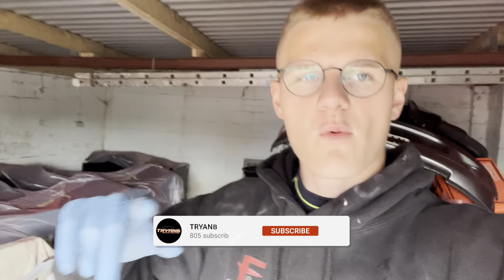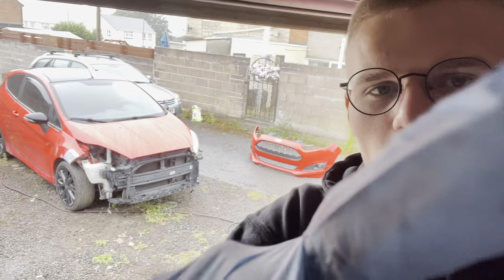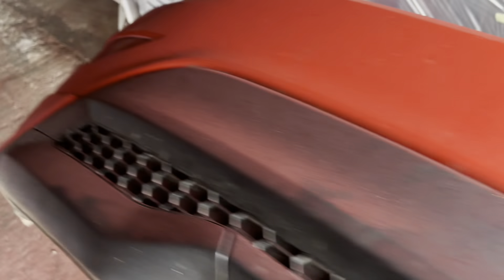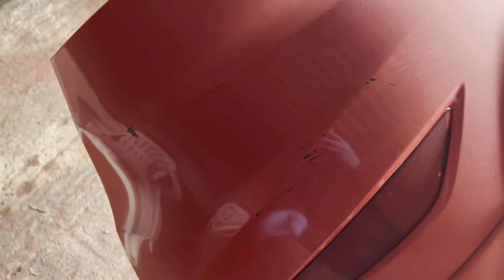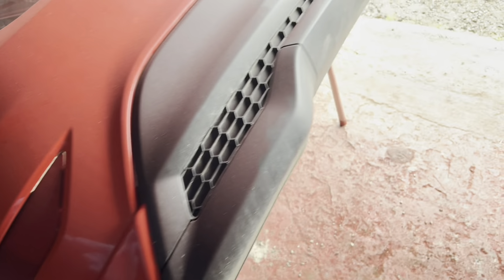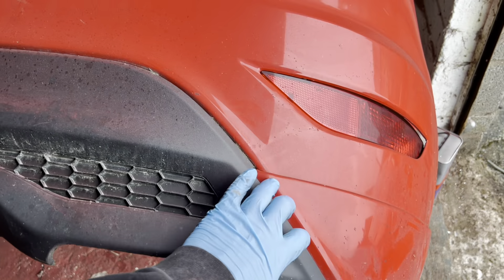Hi guys, welcome to the channel. It's a rainy day, very wet. As you can see, we've got the wing there - I've done a bit of bodywork on the wing. We've got a little bit of bodywork left on the skirt, and then I've got the rear bumper here. I just need to prep this little corner, tickle it with 320, a bit of primer, and sort out this little bit. Then I'll sand these out, blend them out, spot prime wherever needed, base coat, and lacquer the whole thing. I'll have to take out the fog lights and the diffuser because I don't think I'll get masking tape under there.